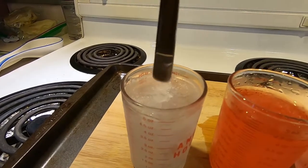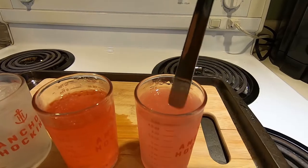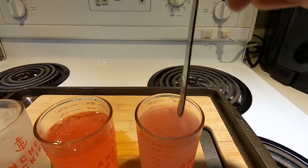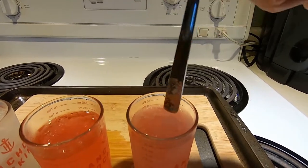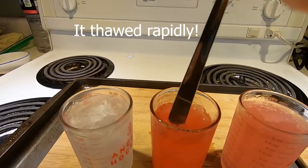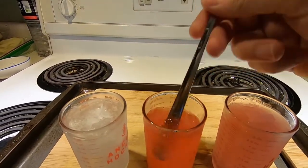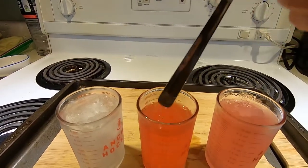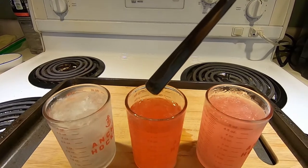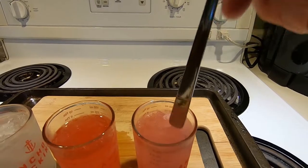So for consistency: the water is completely frozen solid. The 50-50 mix has expanded some but is still a bit slushy. And then with our straight antifreeze — it has slushed, but it's not as hard as it was in the video when I did the trailer inspection. The trailer inspection result was a little more the consistency of the 50-50 mix.